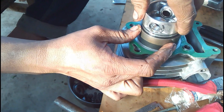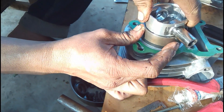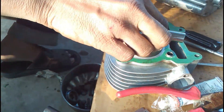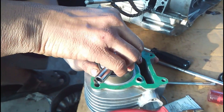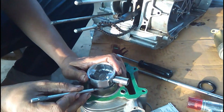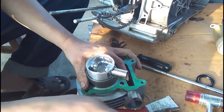Before placing the cylinder, he is actually pushing the piston a little bit inside — the first compression ring and the second compression ring go inside the sleeve, and the oil control ring is halfway inside the sleeve. This is where he will stop, and later he will tap the pin inside and push it all the way through.